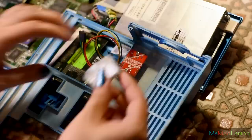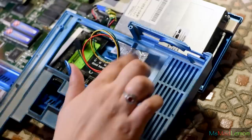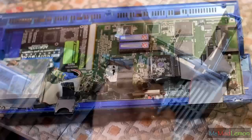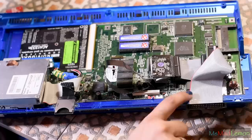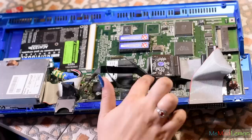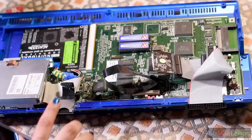I'm adding a square of duct tape — maybe another layer on top — just to make sure nothing shorts through any of the points. I'm paranoid like that. Since last time I did my mods, I put a ribbon cable for the external CD-ROM drive and an SD card extender so you can remove it easily, getting the Kickstart boot logo or loading any OS you want without having to open the Amiga.